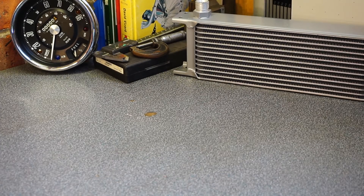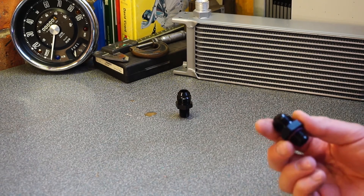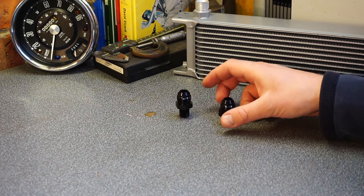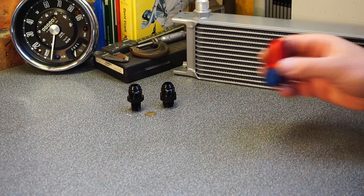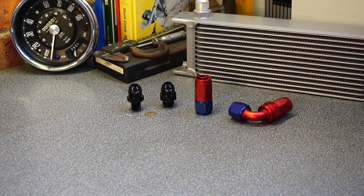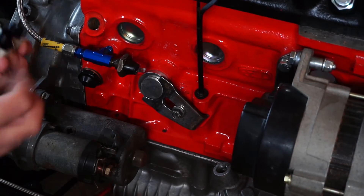So what are we going to need? That there is the filter end — that's the 1/4 NPT to AN8. This one here is a 5/8ths UNF to AN8. So that adapts both ends to fit a standard AN connector. Now for the pipe ends: one straight AN8 connector and one 90 degree AN8 connector. And of course, tube. First step, let's get those fittings on.